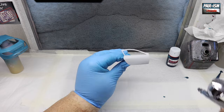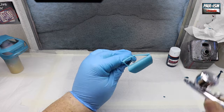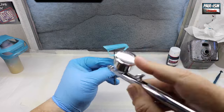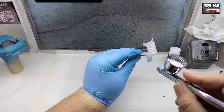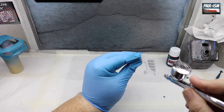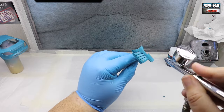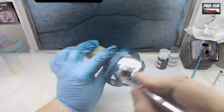On parts like the front bumper, we need to be wary of getting into all those nooks, crannies, and edges. Make sure every coat you put on one body panel, you put on all the others too — otherwise you can end up with a slight colour difference, which is noticeable quite badly on multiple-part bodies like this. So take your time, make sure everything gets equal coverage. Probably seven to eight coats on this, leaving five minutes between each for it to flash off, then coming back with another light coat.